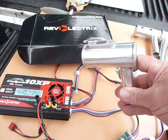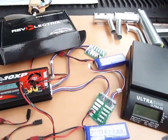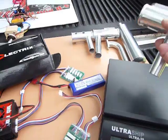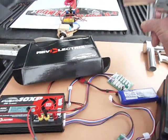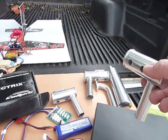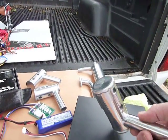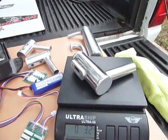Here's something I've had out for a while — it's a profile-style muffler that fits the DLE 20. On the scale it's 2.1 to 2.2 ounces. Nice quality, it's got a larger chamber than the stock muffler. Here's an inverted DLE 20 muffler — for a fuselage airplane where the engine is mounted upside down, inverted. Again, 2.1 ounces. For our 50cc airplanes, a profile-style muffler that works on a DLE 50, DA 50, and a JC 60 — 3.2 ounces.